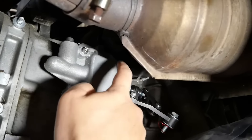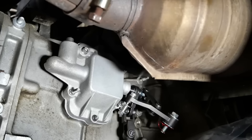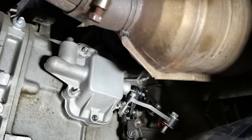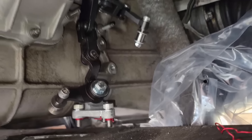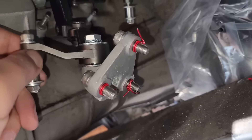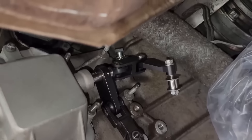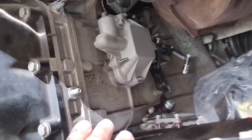Our actuator is in place and the gasket maker is still pretty fresh. I'm getting the nuts — and there's a bolt the kit comes with — to just touch the front of the mating surface. I'm leaving it for the time being; after about 24 hours we can go and tighten them all the way. While the gasket maker is still a little wet, you just want it basically finger tight, which is why I'm doing this all by hand with no power tools. This kit comes pretty much completely assembled down to the hardware. The brackets mount into the holes where we took the studs out, and the hardware is already in there with cable ties attached to show you exactly how it sits.